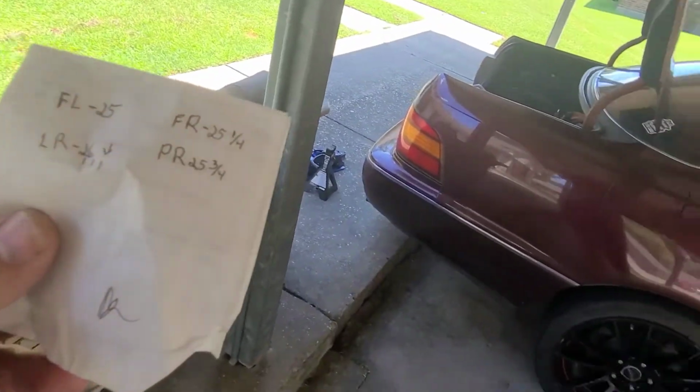And if anybody knows, I run Maxpeedingrods coilovers on my car. They've been on my car for over a year. I've been happy with them. I've done quite a bit of adjusting on them, changing springs, playing with them. I even changed my top hat bushings from the rubber bushings to urethane, because the rubber ones wore out. That is a common issue with those coilovers. A lot of y'all are like, oh, they break. Yeah, if you don't change your bushings on those things, they're gonna break.